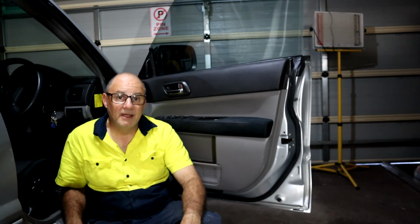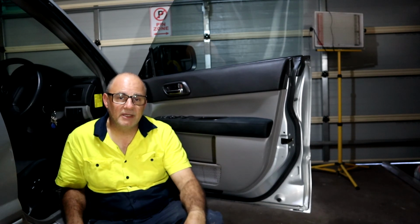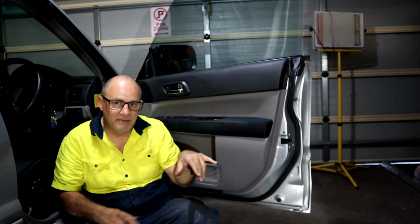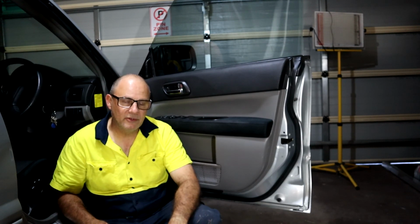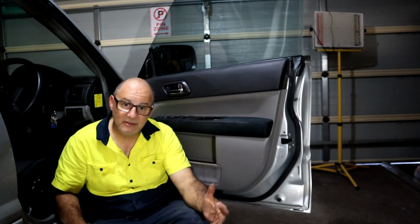I hope you found this video informative and useful for your own needs if you need to replace your window motor. It is something that you could do on your own. There are a few precautions you need to take. The regulator is under tension with that spring, so you have to be careful with that, and also make sure you've got the motor in correctly with the gears meshing, the wires reconnected, and in my case make sure you put in the little plastic trim, take out your light from the door panel. So in 6 months time, when I was looking for my light, I would have gone, where's that light gone? I don't know where these things are. They disappear on you, they just go.